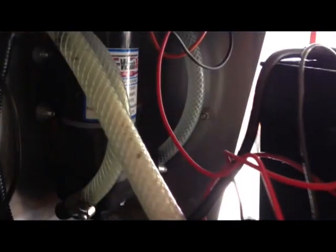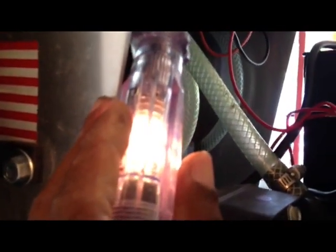I have a tester hooked up here. This is a 12-volt tester — this is just to make sure that this switch works. We're supposed to get a light here. And we have a light, so that means the switch is fine.